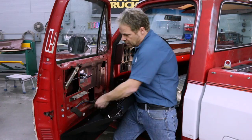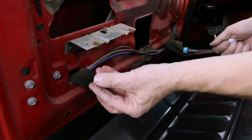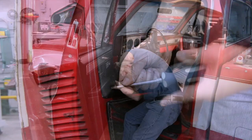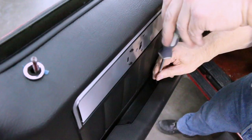There's a new clip for the bezel. The last step is to replace the panel, but since we're in here and our clips are dry-rotted and old anyway, we're replacing them with new units from LMC Truck. The fit of these panels is excellent, and reinstalling the screws was easy since the holes lined up perfectly with the ones in the door shell. The armrest gets anchored to the support from the outside once the panel is on.